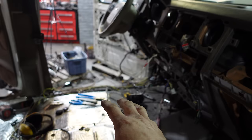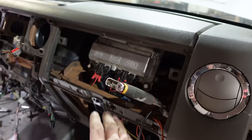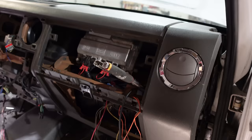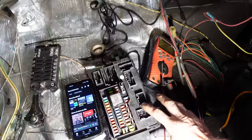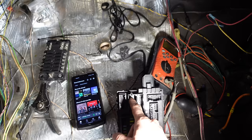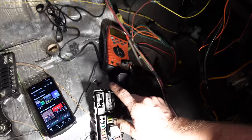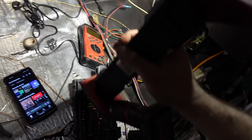The door lock keyless power I'm going to use to power my airbags. I need to grab power for my transmission controller — I hot-wired it before just to see if I got communication. I don't have communication yet, but I did get a pin-out from Excalibur and all my pins that need power and ground are active. I'm going to hook everything up properly now and try to tie into this fuse box under the kick panel. Number one and two are not used — a 30-amp and a 15-amp — perfect for me. I trace the ohms on them and they go to the pins on this plug, so those pins are open.